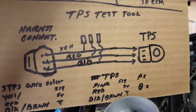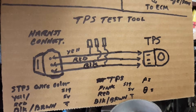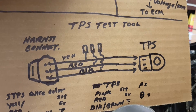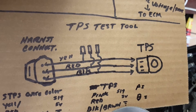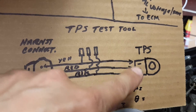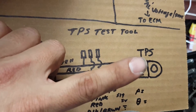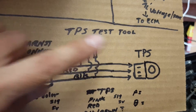Hello brothers and fellow riders, Kim is back cooking up a quick DIY on how to test your throttle position sensor for the correct ohms. In a previous video I explained what the TPS is, what it does, and the problem I'm currently experiencing. I need to find a way to test the throttle position sensor and see if I have a dirty contact point. The wiper blade travels along a contact point, and I'm getting a quick blurp in my system in the 4,000 to 7,000 RPM range.